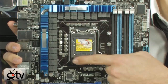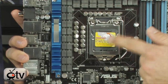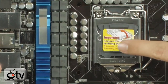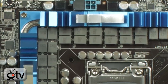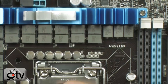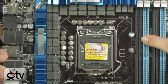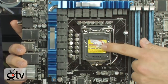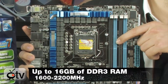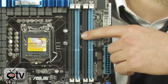It's basically a self-overclocking board. If you want added performance, you have CPU Level Up, Turbo V, Asus Auto Tuning, and Asus Turbo Key. These are programs that let you overclock — some automatically, some fully manual — and they'll give you an increase in CPU performance using the included software. It also supports up to 16 GB of DDR3 memory, 1600 MHz native, or up to 2200 MHz with overclocking.